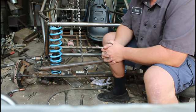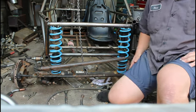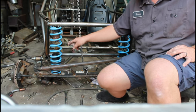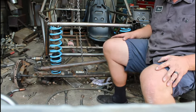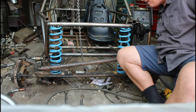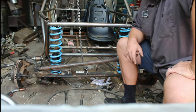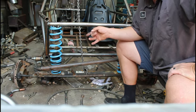But then I started kind of pricing things out, and sure enough, one of these solid beams, and I want you to have in mind, this is effectively a Dana 30 without the Dana 30 center on it. But the knuckles, the spindles, the hubs, the C's, they're all the same parts as a Dana 30. If you cut this apart and put a Dana 30 center in there, you could use it as that. And in fact, the hubs are the same ones. They just have a little stub shaft that doesn't go to anything, to hold the bearing together. And I went to a junkyard and I found one of these, and I ripped it out in about an hour, and I paid $85 for it.